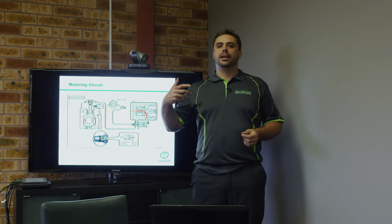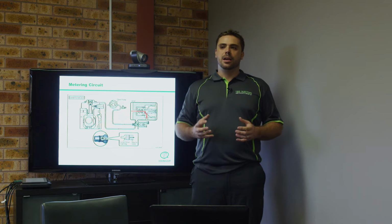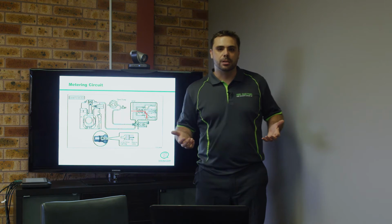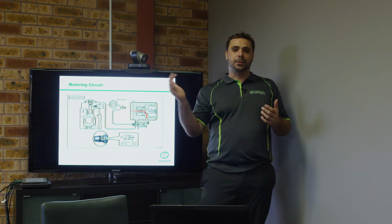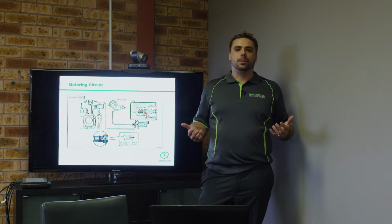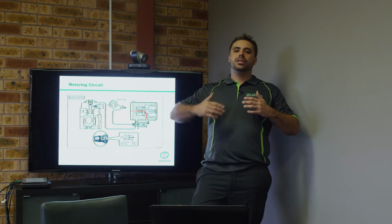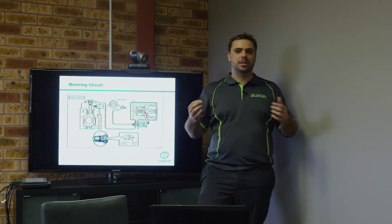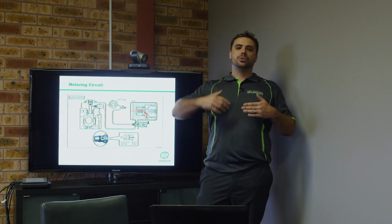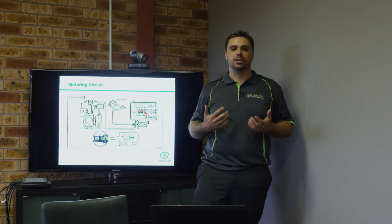Now, I know for, say, a 79 series, 100 series, or 200 series Land Cruiser, 1VD, 1600 bar by that volume of fuel actually takes, say, 12 kilowatts of energy. If you think about that Cruiser running down the highway, to maintain, say, 100, 110 kilometers an hour, it's only using 40, 50 kilowatts of energy, if that. So if you were to stack that 12 kilowatts of useless energy that we're just going to bleed back to the tank because we're not using 100% of the pump, the fuel consumption of that engine would be much higher, and the engine would be so much less efficient.